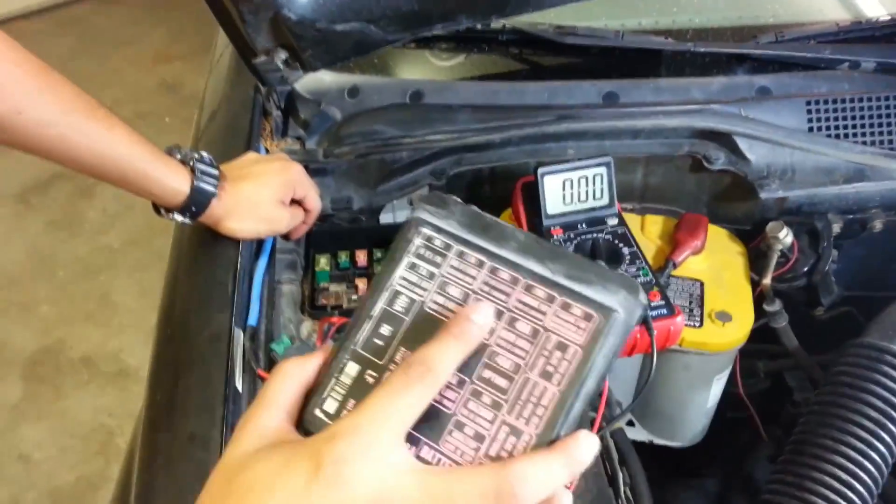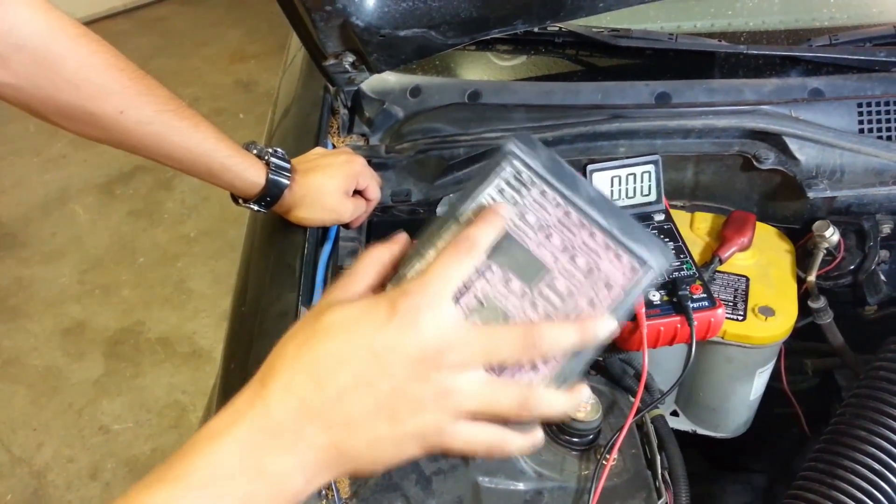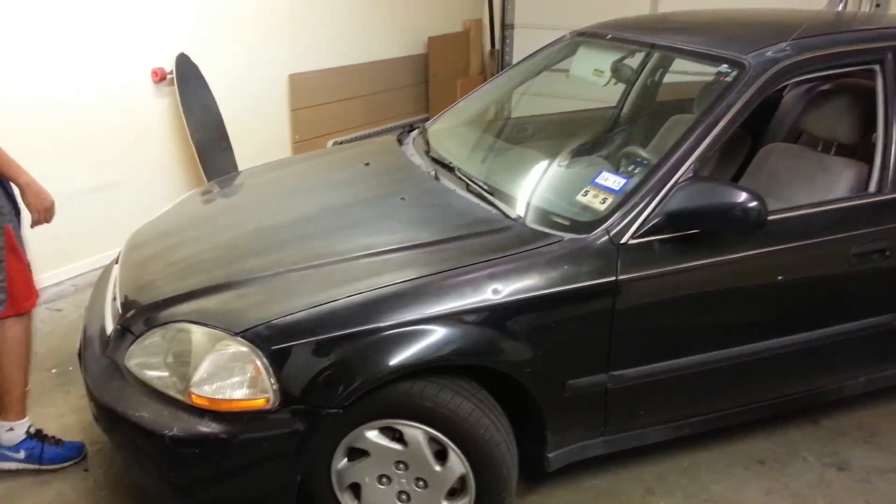This next one is a really common failure - it's called the interior light. Most of the time there's a short circuit somewhere in there, and you can find out really quick with this. All you do is pull the fuse and test it. If your light is off, it shouldn't draw anything. Mine is drawing 0.36 amps, which is a lot over time - it adds up. So I have a short circuit on my interior lamp. Once you find your short, you know around where to look - my short circuit is going to be somewhere near my interior light.